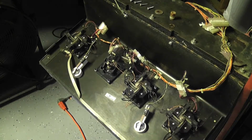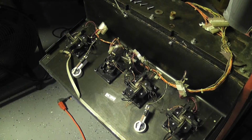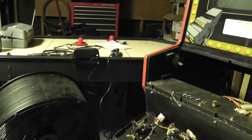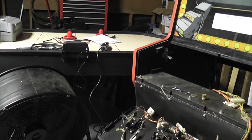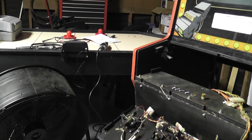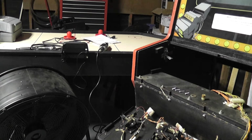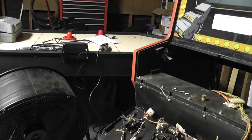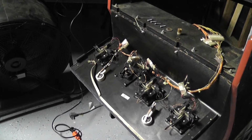All right. Well, great. I'm going to have to get my Dremel out, which I left inside for some reason. So, let me go get that and get this thing out of here. All right, so now I've got the Dremel out here with the cutting wheel on it, and I'm going to slowly cut that thing until I can get it to pry out. And the tricky part with this is not cutting into the joystick shaft. I did this the other night on the other one, and it took probably about 10 minutes, and I'll probably break the cutting wheel I have on there right now, so I'm probably going to have to change it out at some point. But give this a shot, and I'll probably end up muting the sound because this is really loud, and I'm going to be wearing earmuffs while I'm doing this.